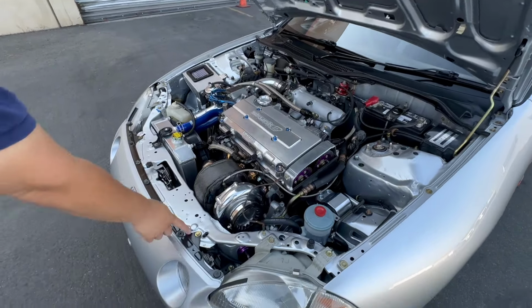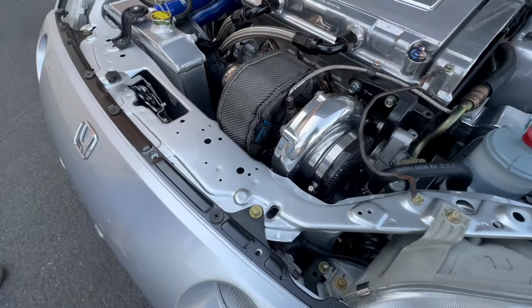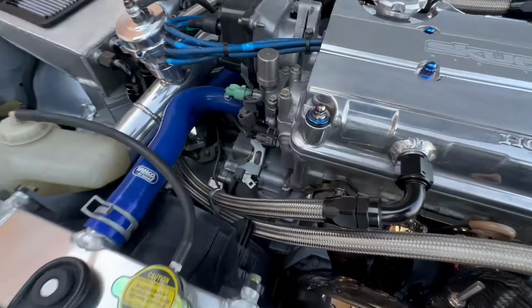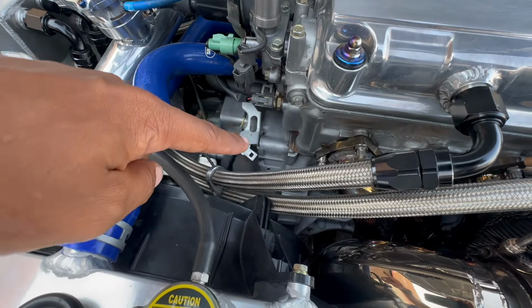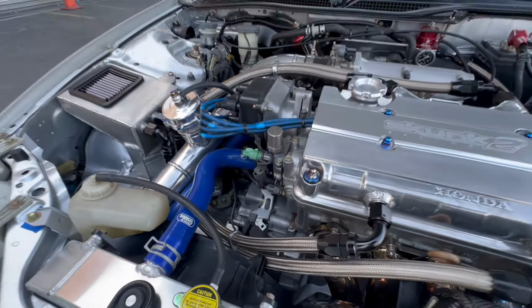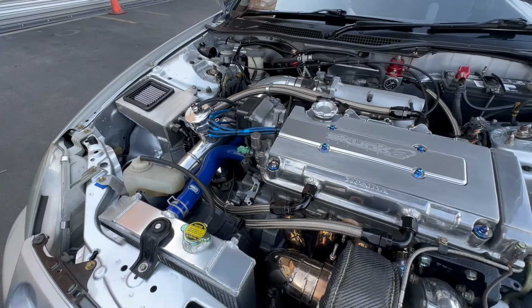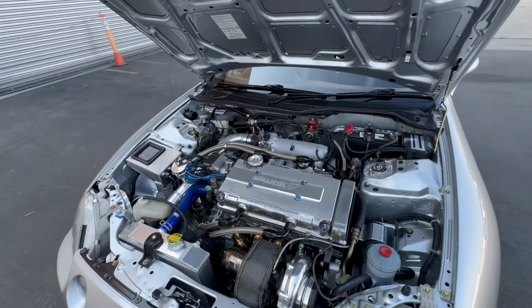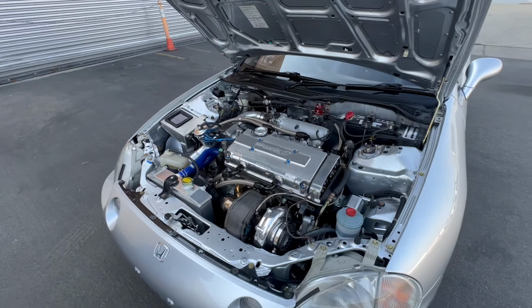We did all zinc bolts. The motor doesn't even have one spot of oil on it. Every time you see oil, it's going to be right where the head and the block meet. None. No oil. When we put the head gasket in, it was copper sealed. Wow. Everything just redone, man.